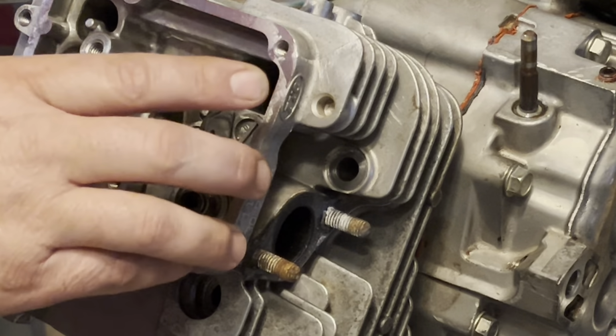Okay, please excuse the lighting. Spark plugs are still out. They're right there. I'm gonna crank it over. Oh, hang on. Gotta have out the levers. Okay. The oil pump should have pumped what it was going to pump. Hopefully. So I'll pause you, I'll put the plugs in real quick, and I'll bring you back and we'll fire it up.